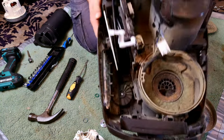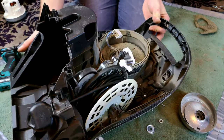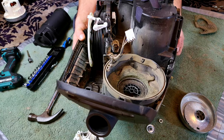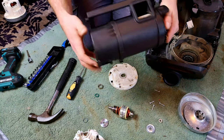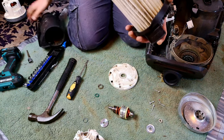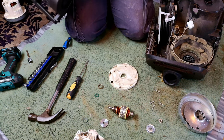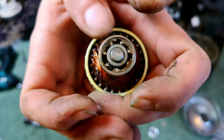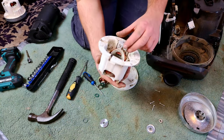What I thought we would do is have a look at the state of the inside of these, because I was always a little bit worried about a bagless Miele. Everybody was. Miele are bagged, and they jumped on the cordless bandwagon, and it seems to be a pleated HEPA filter. We might crack that open in a minute. You can wash it, look, it just comes out. It's actually not in bad condition, especially since the guy said he used it for the car. It just seems fine dust, and I cannot help but think that might be what killed the motor, because if we pop open the working back bearing, it's full of dust in there. I think this just isn't a fan of fine dust, which cleaning the car obviously is.